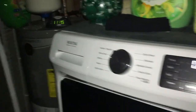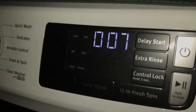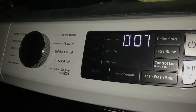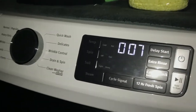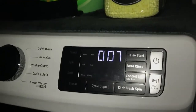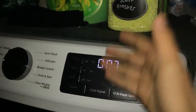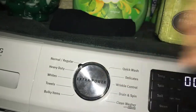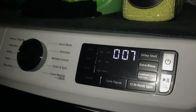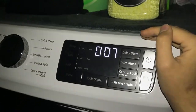So, let's close the dispenser drawer. And number 7 is spin test. It actually kicks the drain first, and then it will reach up on speed, which is not actually full speed, almost about 900 RPMs. It actually runs around 850 or 870 RPMs. During the full spin cycle, around normal cycle, is 1160. So it actually runs the full speed to get the clothes all dry.